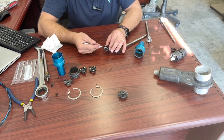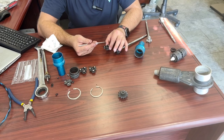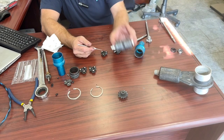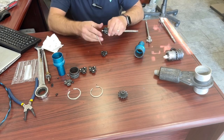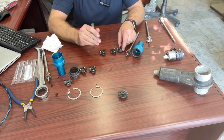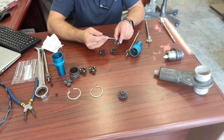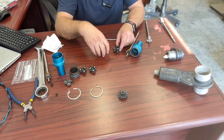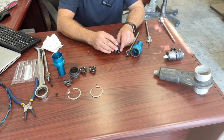In all these units there is a spacer inside where the gear goes. There are actually two different sizes of spacers, so you'll want to pay attention to where they go. If you buy a whole kit, the spacers are already in the right place, so just follow the directions of the kit. Assuming no one has been inside the brush, they should be in the right place too. You're going to have two thick ones — that's a thick one there — so thick, thick, skinny. The thick one goes on these two in between those connections; the skinny one goes in between the turbine and the final gear.